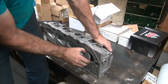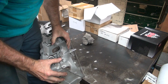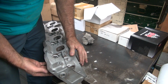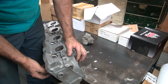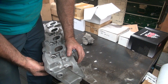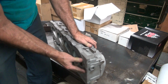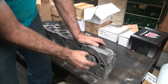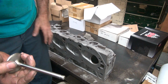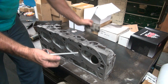Gets tight right there, right where that valve seal's at. Got Teflon PC seals over there, which are fine. Nice and heavy duty. We got clearance in them. Doesn't feel round, but it's got clearance, so that should be a usable valve. Oh, that's tight. Another brand new valve.